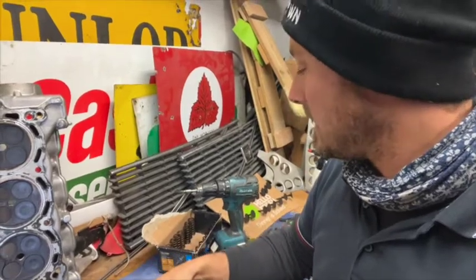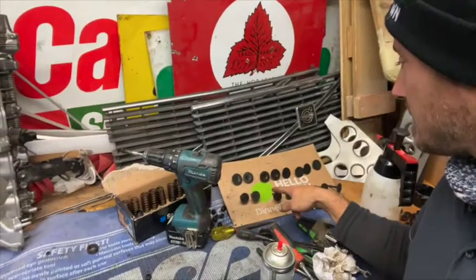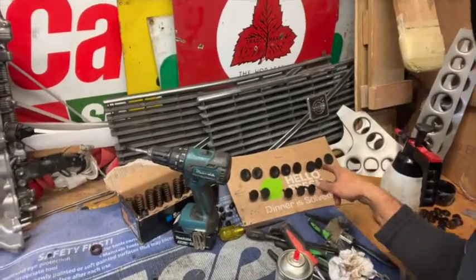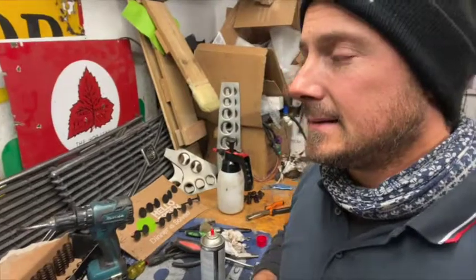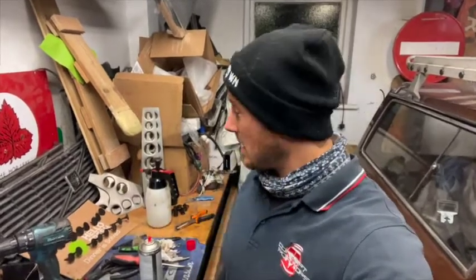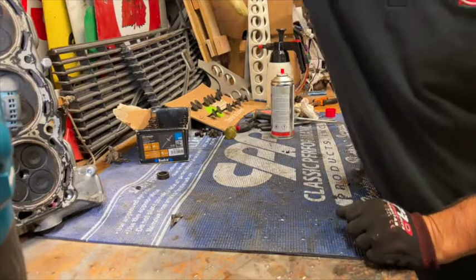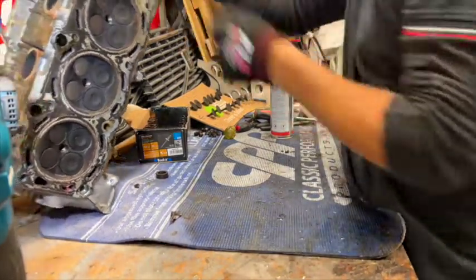Then clean all the buckets behind it, label up all the valves - like I've done here, these are all the valves out the other head. Label all the valves up, all the springs, all the keepers. And then I'm going to degrease it, jet wash it, and get them ready to head off to the machine shop to get skimmed. Then as soon as they're skimmed, they'll come back here and we will re-string them all in reverse order. There's an absolute shit ton of valves on these. So let's get to it - we'll start off by unstringing the valves. I'll show you through the first couple and then we'll just crack on.